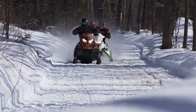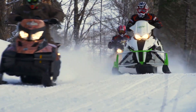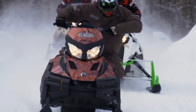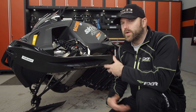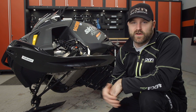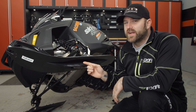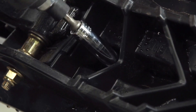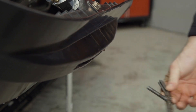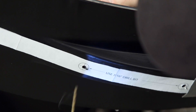The concept is really quite simple. Darting and a nervous front end feel are the result of your carbide runners falling into other people's ski tracks and following them instead of the path the driver is steering towards. There are a number of different options on the market for fixing this problem, and the design concept behind most of them is very similar: smooth the snow out in front of your carbide so it can cut its own path instead of following another one. Think of these things as tiny little trail groomers for your skis — they effectively reset the snow in front of your runner so it has a fresh surface to work with.